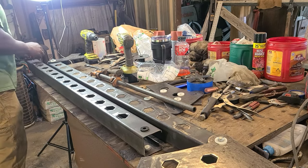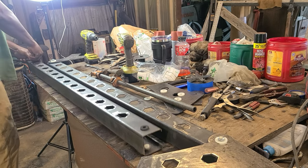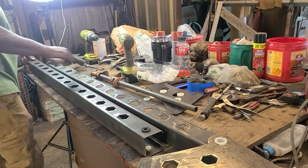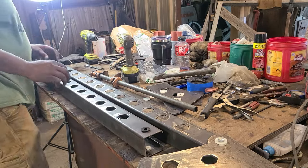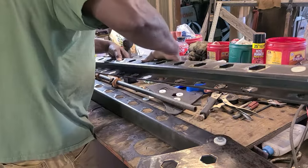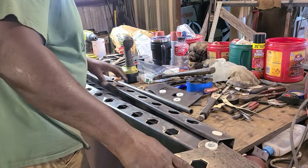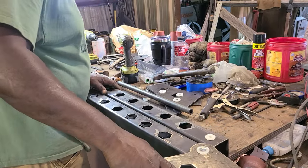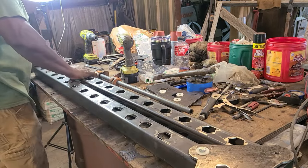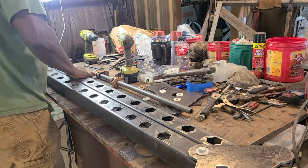I also come on top of that with another three-eighths flat washer to make sure everything sits flush and there is no play. So there are actually four washers on each end of the upper and lower control arm — four half-inch flat washers and four three-eighths flat washers — to include the exterior flat nylon washer after the nylon flange washer. Here you see me putting them back together to make sure everything lines up.